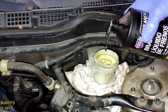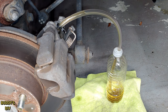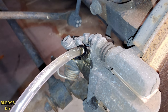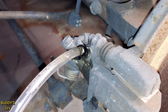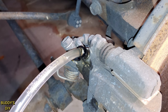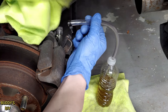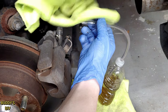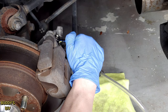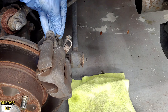You'll notice that after pumping for a bit, the yellowish brake fluid with little bubbles turns into a nice clear white brake fluid. Sometimes even after the yellow fluid is gone you might still see little air bubbles coming out of the bleeder valve — just leave it open and let all the air bleed out before closing the valve. Once line one is done, pull the tool out, wipe everything dry since brake fluid will rust surfaces, ensure the bleeder valve screw is fully tightened, and put the rubber cap back on the bleeder valve.